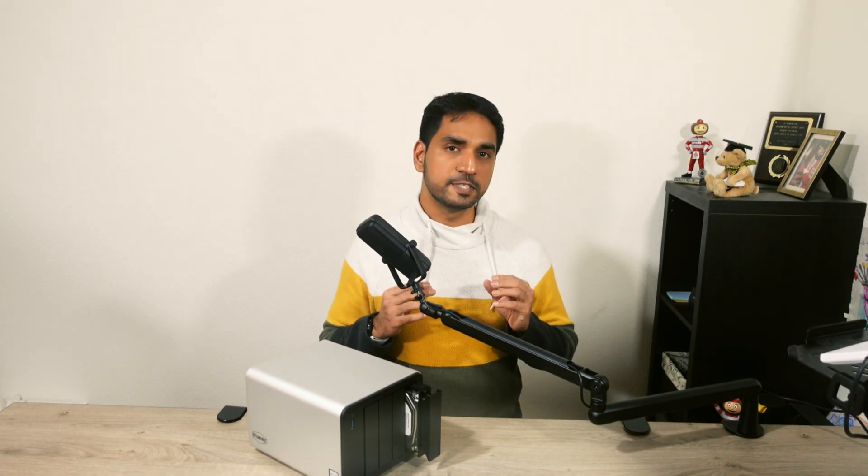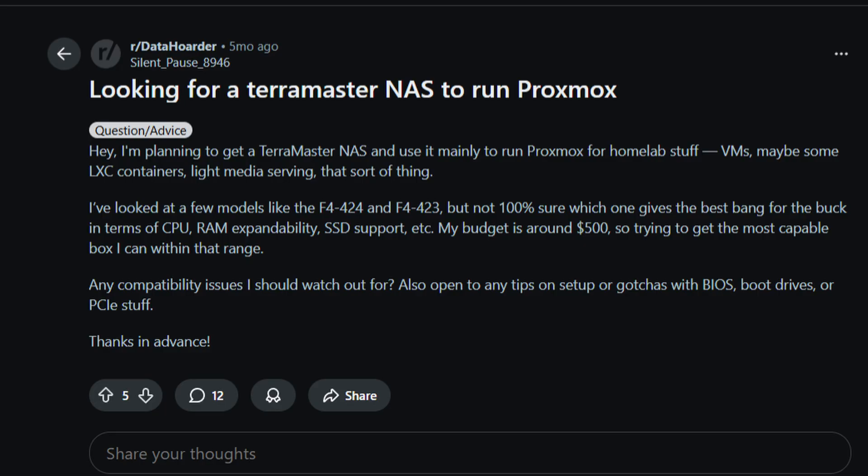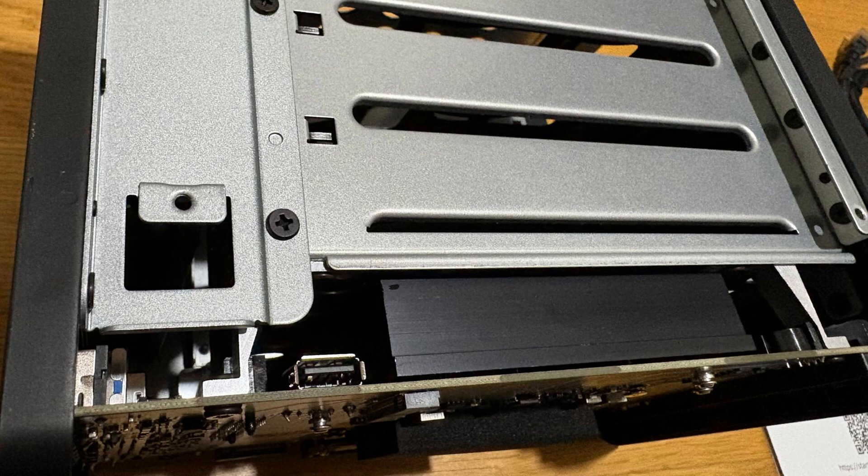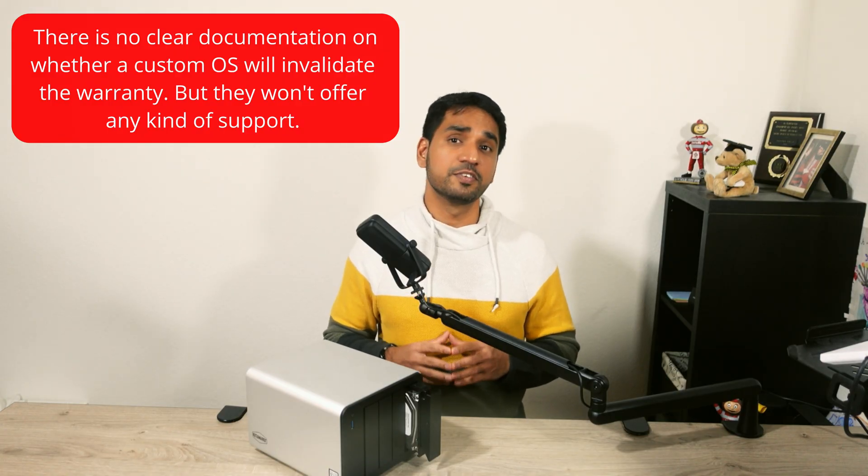One final point I would like to discuss is the operating system. The TerraMaster OS has improved significantly over the years and is perfectly sufficient for most users, but it can be a bit limiting for advanced users. So it is no surprise that people have combined TerraMaster's advanced hardware with custom operating systems such as Proxmox VE, Unraid, and TrueNAS. You can even install Synology's DSM operating system on TerraMaster NAS, giving yourself a Synology NAS with better hardware. I won't go into the details of how to install these custom operating systems, but just know that there is a hidden USB port inside the chassis and you have to disable the TOS boot first option in the BIOS settings. You could possibly use the other USB ports, but I did not try — if you know, let me know in the comments.